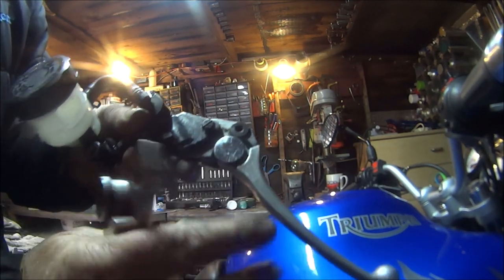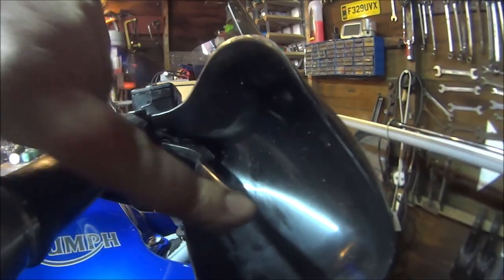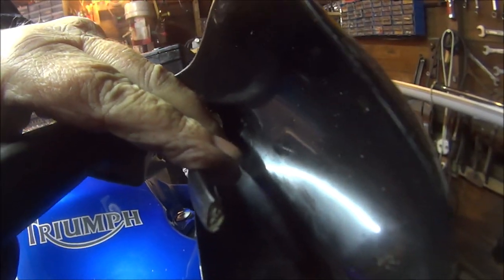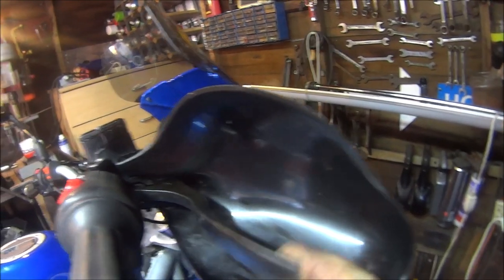Okay, so there it is, all buttoned up, but it didn't quite go to plan as I was expecting. Let me show you what went wrong. Basically, these adjustable finger reach brake levers are too fat for my handguards. This is the only one I could find without the adjuster on it, but it is snapped — they are £12 on eBay, so I will be sourcing one of those and it will be black to match the clutch lever. When I tightened the handguard up, everything seemed all fine, but just deep inside there this cover was pressing on the brake slightly, holding it in, which means the brake light switch wouldn't go off. I did try to file the hole a little bit bigger but no success.